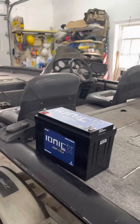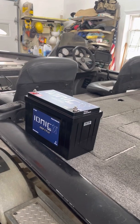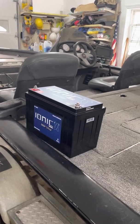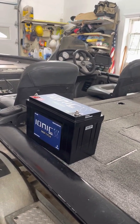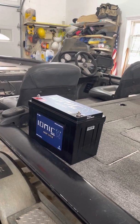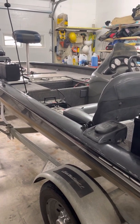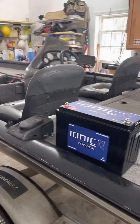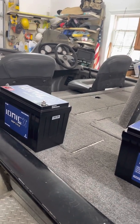You can do a 36 volt single battery or three 12 volts. I decided to stay with three 12 volts because should you have a problem with one of the batteries — whether you're in the wilderness or a faraway place — if something goes wrong, you can just get a 12 volt battery, pop it in series, and continue fishing. Whereas if you have a problem with that single 36 volt battery, you're dead in the water. I've had a lead-acid cell burn out and had to go to a Walmart an hour away while fishing in northern Maine — I didn't want to be stuck without being able to fish for the rest of the week. That's just a personal preference; more guys I talk to say stick with what you know.